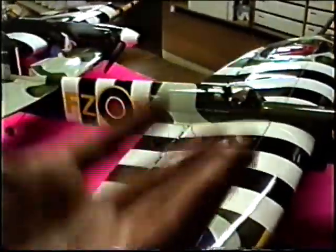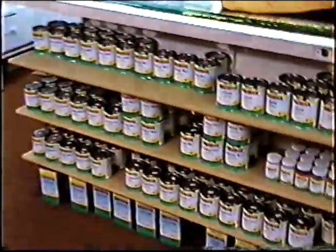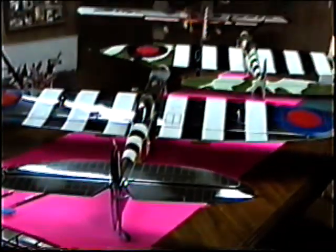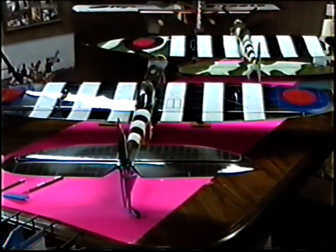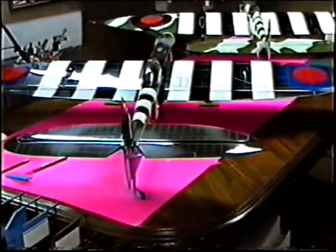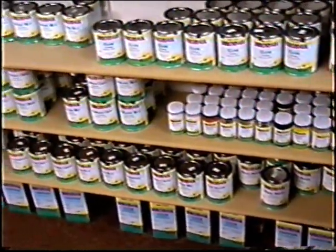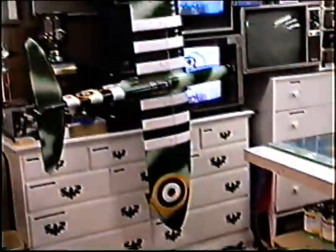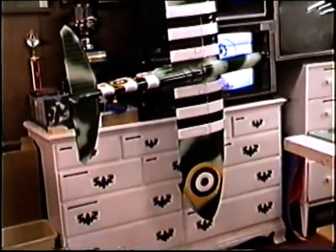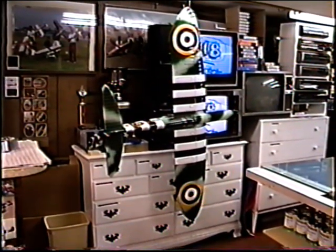The biggest thing I've learned from all the Brodak testing: if you stick with Brodak Dope from the first time you put dope and thinner on the wood until it's all finished, buffed out, and you don't go mixing and matching, you're going to have a real good chance at a super finish without a lot of work. The minute you introduce some unknown quantity — start adding DuPont thinner or some other brand — you start having problems. I had a real fit talking to somebody who used up old paint from 10 years ago, didn't even remember the brand, poured them all together, and of course it didn't work. Stick with all one brand — in the long run it'll be cheaper and your finishes will be better.